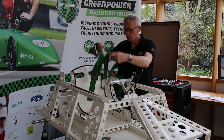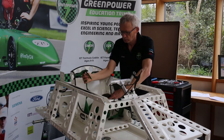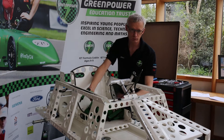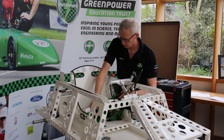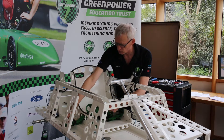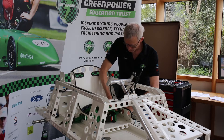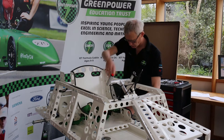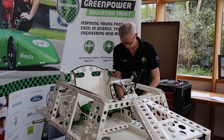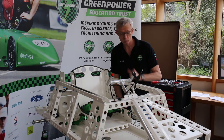The way to get this installed in the car is to lay it in the seat. A good tip to make sure you've got it the right way around is that the red part of the latch faces to the left. I'm going to pass the lap belt on the right hand side through to its fixing point on the chassis, and the same with the left hand side, making sure that you don't get any twists in the belt — twists could possibly harm the driver if there's a big crash, or they could actually weaken the belt.